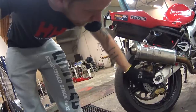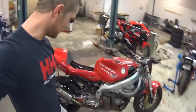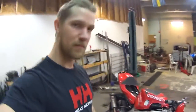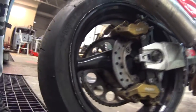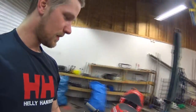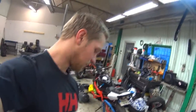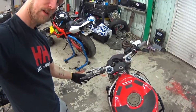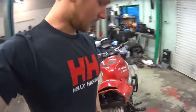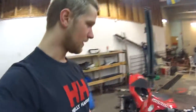I've also put my other brake setup that I had on the other Firestorm on this one. I had some problems with it after about five minutes — the disc was almost blowing; you can see it has heat marks, blue marks on it. This brake wasn't relieving pressure after I applied it, so I could lock the rear tire. But hopefully I've fixed that as well — I re-bled it, so now it should be in tip-top shape.